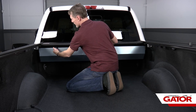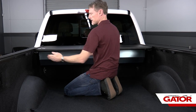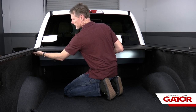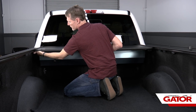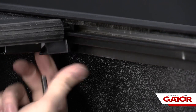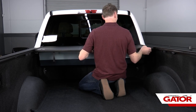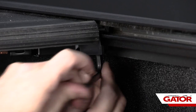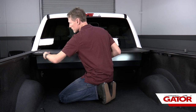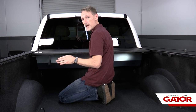Now I'm going to pull the strap that retracts the latches past our first latch stop. I'm going to pull the cover and set our adjustable latching positions, pulling it to a point where I think might be a good place for it to latch. I'm going to slide my latch stop into the latch. Once the latch stops are locked into the latches, I can still adjust that cover back and forward a little bit. Once I find a good location where I want the stop to be, I'm going to go ahead and tighten down those latch stops with the allen wrench. Once we've got that latch position set, pull the cord — that retracts the latches — and make sure that works perfectly. We're going to adjust the other two latching positions the exact same way.